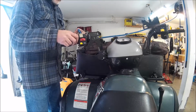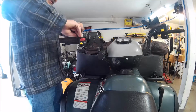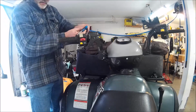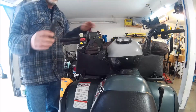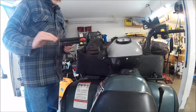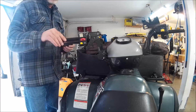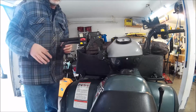So you try to fit the end of your air nozzle in between the bar and the grips, and give it a good shot of air. There you go. Worked like a charm. That's fantastic. My next thing now is I'm going to clean these up really well, use soapy water or whatnot, so that the new grips can slide on there a lot easier.